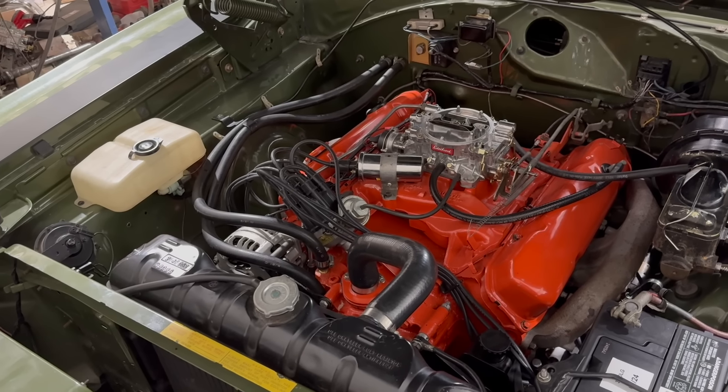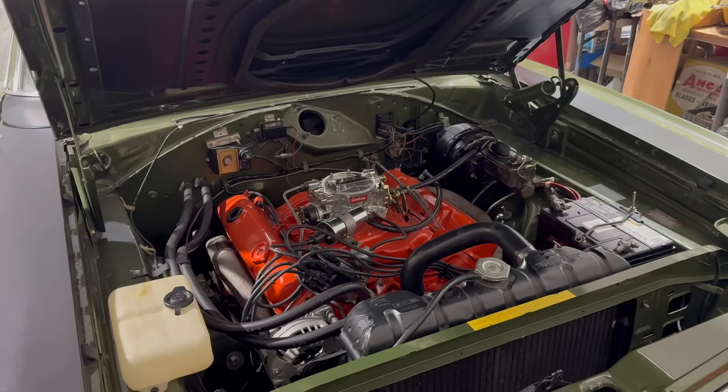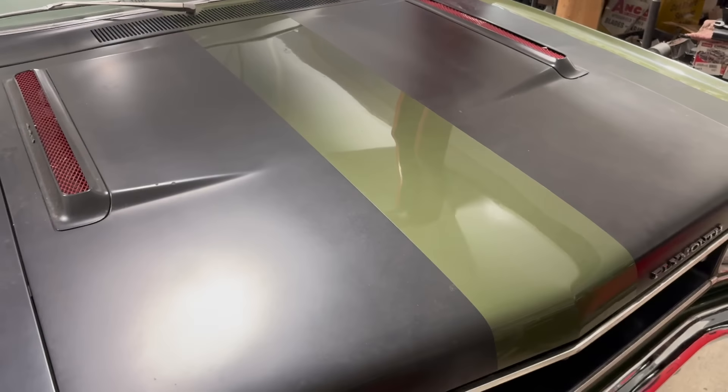That is a great way to blow up your brand new engine. I'm not saying I'm a brilliant super genius or anything, but I have put together a lot of engines and I always check the pickup fit — at least make sure it's close. In the first video, I pointed out that this air cleaner was hitting the wiper motor. That's because this is a correct '69 air cleaner, but the engine has '70 valve covers, so they'd flipped the breather around so the hose could run to the other side. I've since flipped it back the correct way and now it clears. We're going to solve everything wrong with the top end using a set of reproduction valve covers — decent quality parts, but not amazing. That's a project for another day.